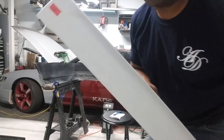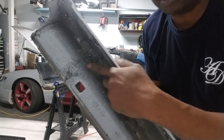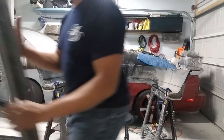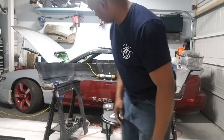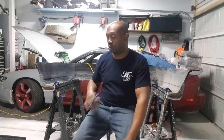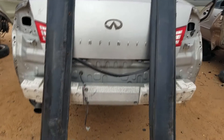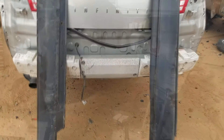As you can see, it's plastic welded — but you can't tell on the outside. On the bottom, yes, and on the inside, yes, because we didn't clean that up. But the problem is they're an inch and a half too low. The front bumper was started first, and it's an inch and a half lower than the side skirts. The front bumper is sitting at about five inches off the ground, and I still need to go down probably another half to a quarter inch in the front. The side skirts were sitting at six and a half, maybe seven inches, and they weren't fully up where they were supposed to be.